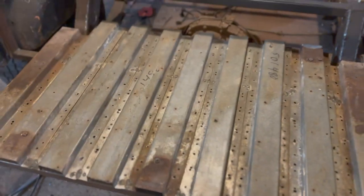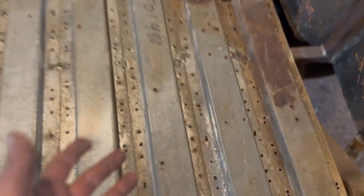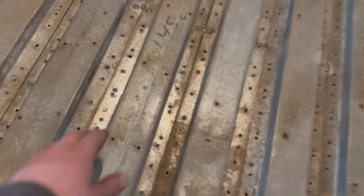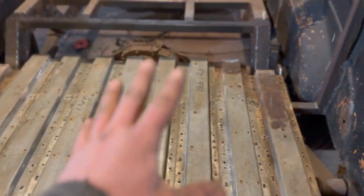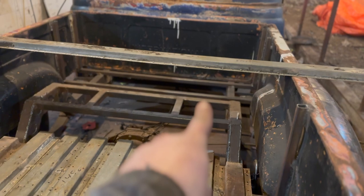As for welding, I still have to come in and add a tack or a couple tacks all the way through — I'm not going to seam weld this. Every so often we'll add an inch-long strip on each piece to make it one, but there's no point in full seam welding. Look at all the holes — it's going to breathe very well. We're never going to put a tonneau cover on this anyway, and if we do, we'll address that down the road.